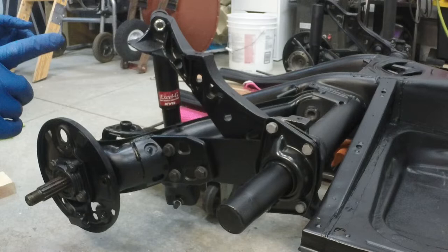Next, if your car is running and driving straight and you want to keep it aligned, you need to mark with a chisel, file, or marker on the diagonal arm and the spring plate so that when you put it back together you can line it up in the exact same spot. Third, if you're going to be replacing your bump stop, it would be a good time to take it off, do this job, and then put it back on, as it will limit the range of motion of the diagonal arm and make reinstalling the spring plate more difficult.